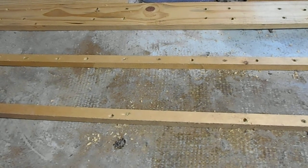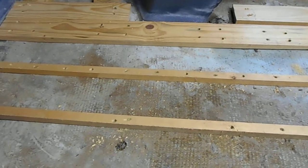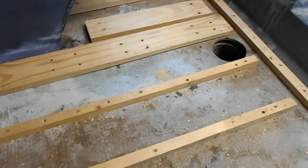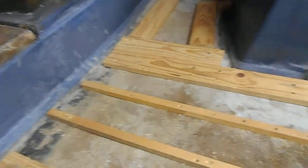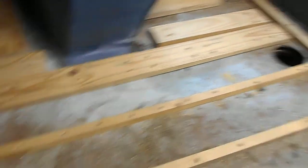Also, when I got up on the plywood it felt like I was on a diving board. So what I went ahead and did was make it like a trough — in other words, if any water gets inside of here it still has someplace to go; trash, water, leaves, whatever still has someplace to drain out. Typically, this boat won't be an outside boat; it will be kept in the garage, so I'm not worried about debris. I thought doing it this trough system would help with the floor.